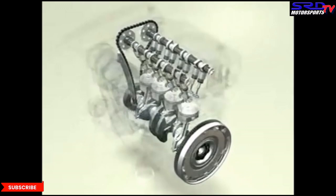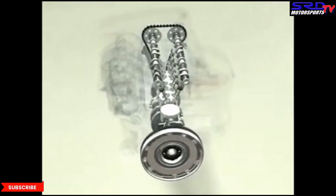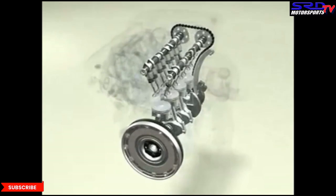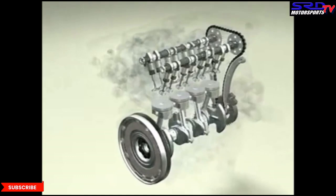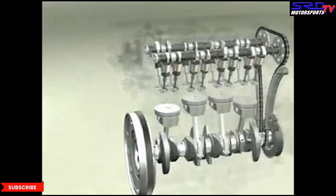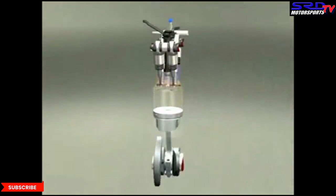On a turbo motor it might take just two seconds to rev from 5,000 to redline compared to a naturally aspirated motor, so crankcase ventilation is more crucial on turbo — and it's coming from the crankcase, not the valve cover. Eventually with some blowby from wear it gets worse and worse. This is why it's really worth talking about — the windage loss is quite significant. On a dry sump motor this is almost all free power because they run on vacuum, which is really good. Even on motorbikes the cylinders are all compartmentalized so it's less of an issue.